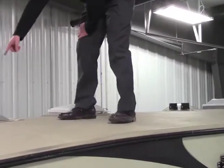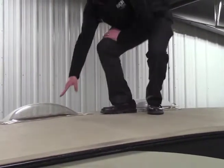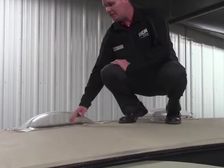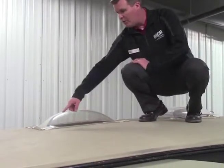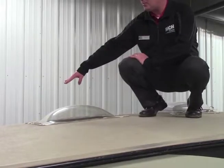I'm also doing the same with my skylights and my vents — I want to make sure that all of the sealant is in good condition. The sealant is a rubberized sealant, so it does have some flexibility to it, but it will crack over time. So we want to make sure that all of the sealant has its 100% integrity.